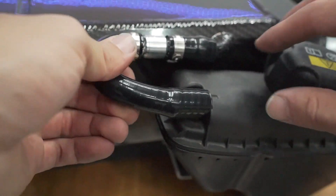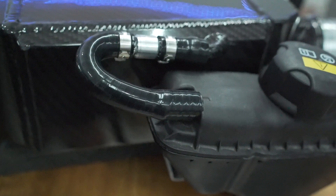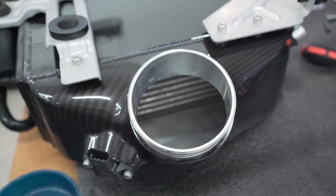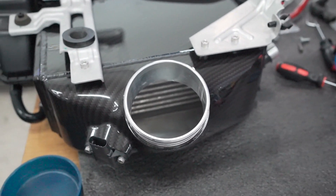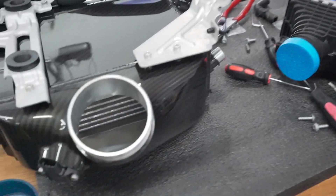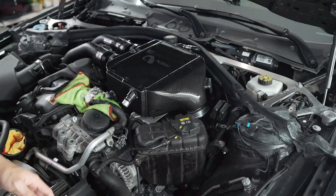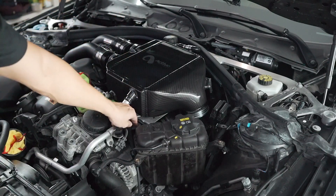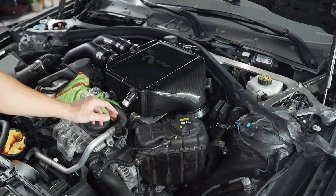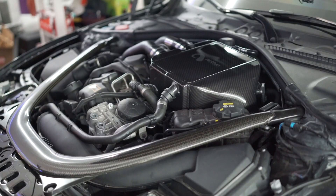Just like that, the Active hose connector is all buttoned in — it's on solid and goes on perfectly. Great design by them. Right there you can see the aluminum core — definitely better quality and better built than the OEM one. Now all you have to do is reinstall in reverse order, make sure all connections are tight, everything's seated onto the grommets correctly, make sure none of the hoses are pinched, and then connect everything back together. We're going to refill the coolant and then reset everything on the car's computer.